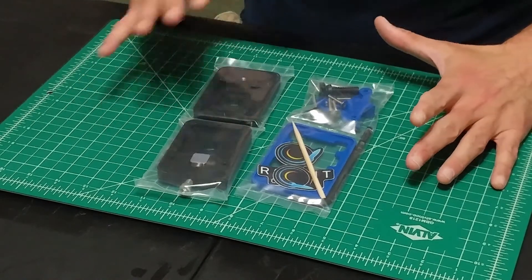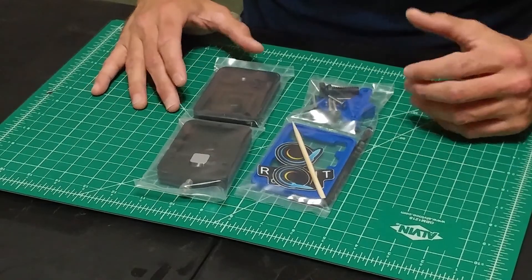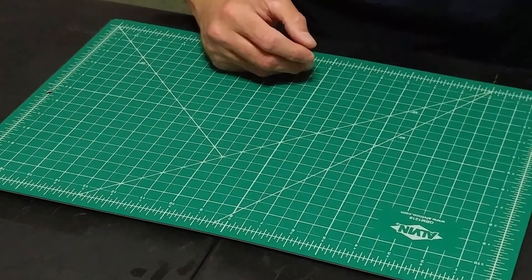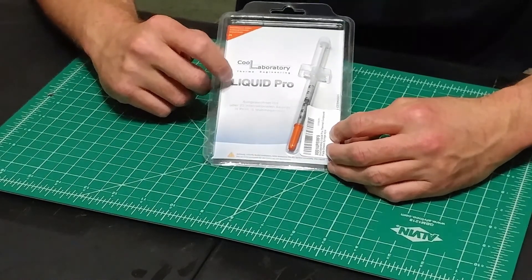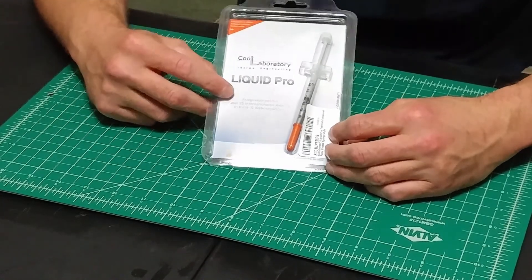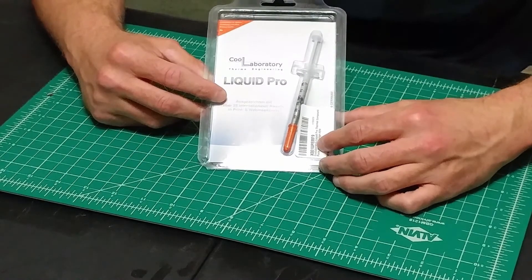This kit is not designed for CPUs such as Coffee Lake or Kaby Lake. If you're not sure about which kit to get, ask on a forum such as OCN. The next thing you'll want is some kind of thermal paste to replace the stock thermal paste under the IHS. I went with Cool Laboratory Liquid Pro. This paste is liquid metal and costs around $12 on Amazon. Be aware that liquid metal is conductive and can short out connections on your CPU PCB if you're careless. Be careful when using liquid metal and take the proper precautions.